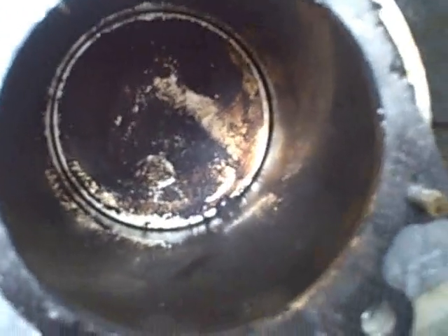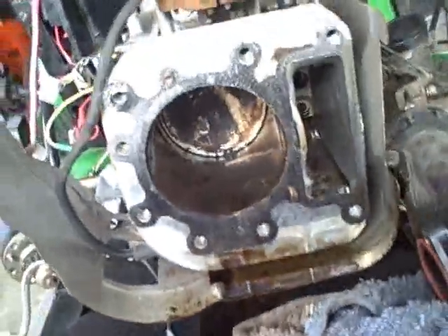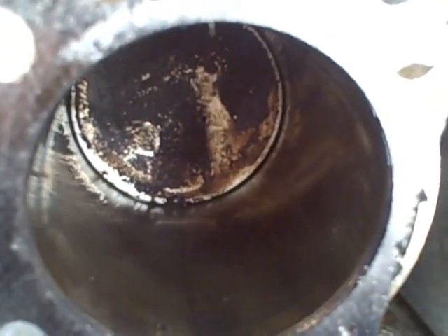Let's take a look at the inner part of the engine — there's the piston back in there. The inside of the cylinder wall looks pretty good; there's a slight gouge, pretty nominal, that I can slightly feel with my fingernail. You can see all the carbon on the top of the piston head, which is not unusual considering how this thing was taken care of. Now if we crank the crankshaft, this piston should be moving, but as I turn it both directions, the piston is not moving at all.